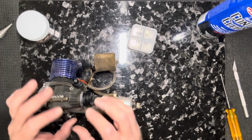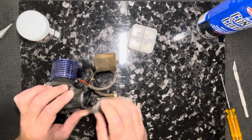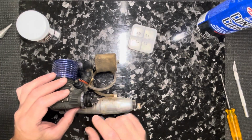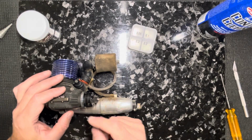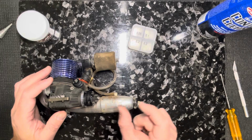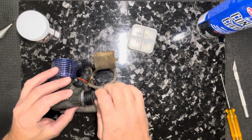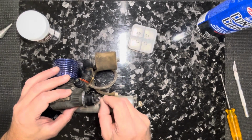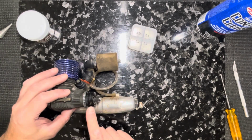You know, hearing that you need to have room for expansion with the heat and all that, which you do, but it's not as much as you think. So if that clutch bell is really going back and forth, let's say a millimeter, just for conversation, those bearings are just getting slammed on the gas, off the gas. Because if you look at your car and you hit the gas while it's running, the clutch bell does this. So the more play you have, I think, the more side load on those bearings, which kills them super quick. So you take a lot of that side load off by taking up that space with your shim kit, okay?